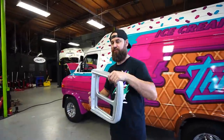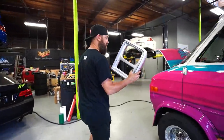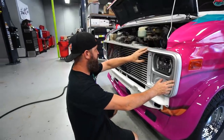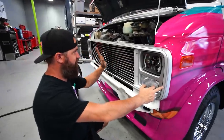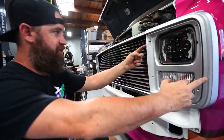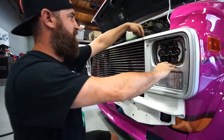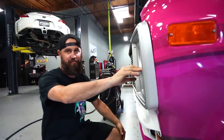I've just got another delivery — this is our driver's side headlight frame. As Evan mentioned in the last video, this is like our third set of these, but we finally got it figured out and we got the right ones. We just got to do a little bit of adjusting. We've got this piece here and one for down here — we'll go ahead and get that painted and put on. One thing we noticed is that our grille actually lays back about an inch and a half too far. It's very upright where these panels are actually pushed forward. It might be for a different year or maybe it's from a C10. What we're going to do is modify the feet on the top of this and kick it forward so that it matches the angle here — it should be as simple as just making a couple little brackets.